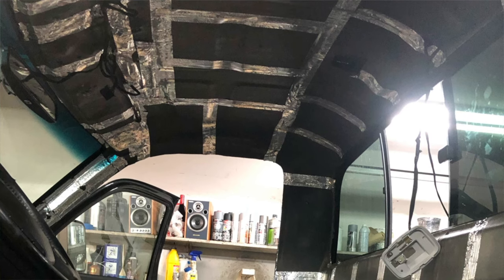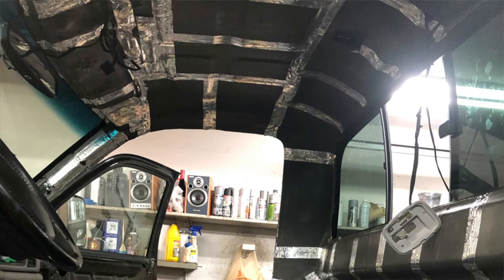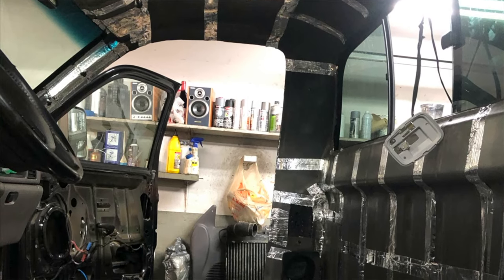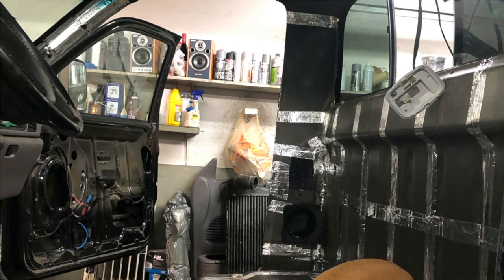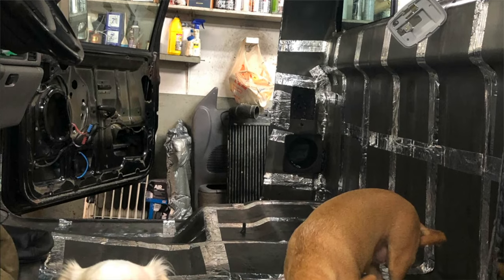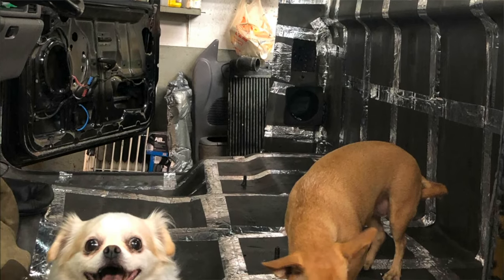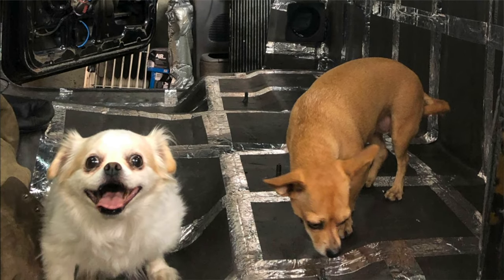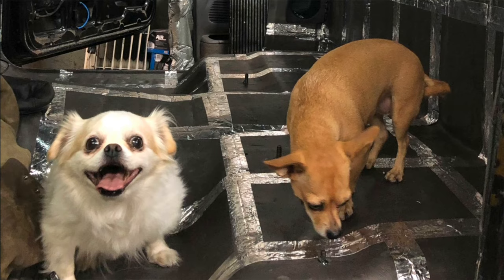In terms of pros and cons, I might have a bit of a biased opinion based on how much dirty stuff I do with this truck, but I don't really see a lot of cons. The one thing about carpet is that it's going to probably provide better sound deadening. But I actually went ahead and put sound deadening in when I had the carpet out — two layers of it: one is like the Dynamat stuff but a knockoff brand, and the other is a closed-cell foam.